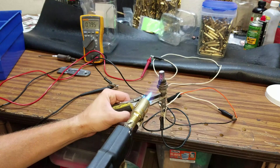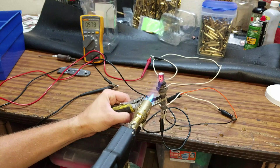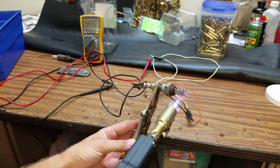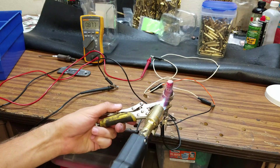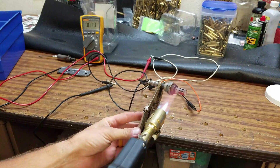Slowly climbing up — 0.9, see it on the meter there. Get this thing nice and hot all around. See the meter readings: 0.9. This is a good O2 sensor.